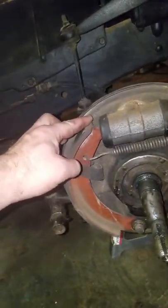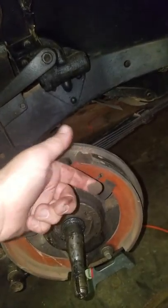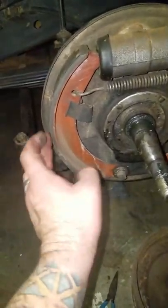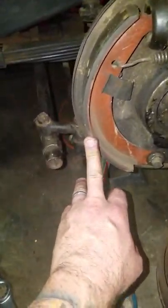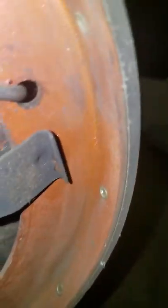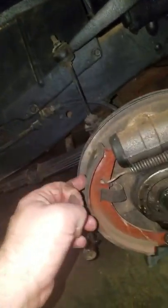What I'm showing you today is actually the brakes — how to get to them. These brakes, which I'm very fortunate, are fine. There's no problems. There is some brake dust, so it has been driven a little bit. There's some wear on them, but they are not bad enough to where I have to replace them. There's about a quarter inch of brake pad. On this 1933, the pads are actually riveted on. You don't replace the metal part — you keep that, send them out, and have somebody rivet new padding onto them.